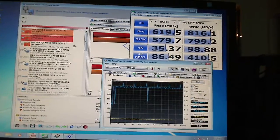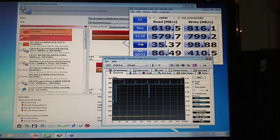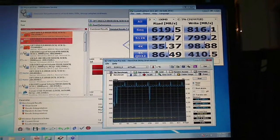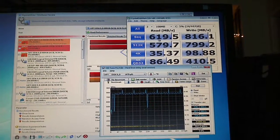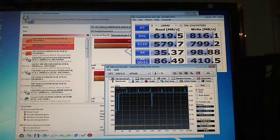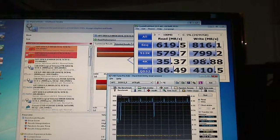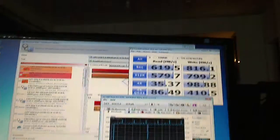Overall, extreme performance — not quite 550 times 2, but you always have degradation the more you add. I assume this RAID card doesn't give as good read performance as some of the onboard Intel controllers from newer P55 generation boards. Until Intel comes out with its newest RAID controller, we're probably not going to see TRIM support for a while. So yes, you're going to get degradation, but as long as you secure-erase every once in a while and rebuild your RAID, you should be getting some crazy performance.